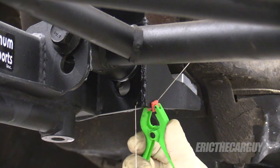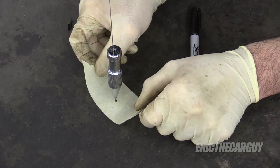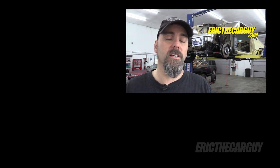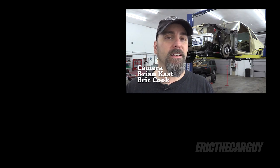In closing, squaring a K-member is critical to the alignment of your suspension and actually kind of your whole vehicle in general. In fact, the next time I go to build a vehicle, the first thing I'm going to do is check these measurements. Remember to find fixed points on the body, not necessarily the suspension — my parts were all brand new so I felt I'd be okay, but Maximum Motorsports recommends fixed points on the body. Also, how you hang the string is extremely important — make sure it hangs down straight and true. And a tip: hold the tape under the plumb bob rather than trying to chase it around to make a mark. I'll post links in the description to the instructions from Maximum Motorsports. If you have automotive questions not covered in this video, head to the car guy community site linked in the description. Be safe, have fun, stay dirty — thank you so much for watching, I'll see you next time.